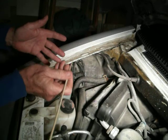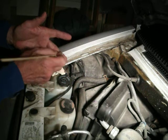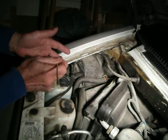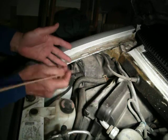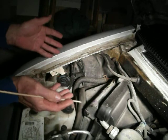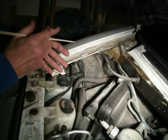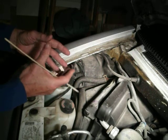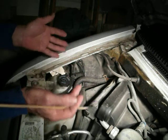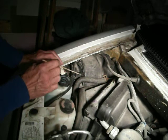So if you take a little piece of wood or something and just run the brushes backwards in their holders, blow them out with air, get some of the dust out. Mine seemed to be free. I also cleaned out the commutator grooves with the same little chunk of wood. I don't know what stopped it from running. When I got it out of the car, there didn't seem to be extra friction there, but once I put it back together all lubed up and cleaned out, it worked. So whether a brush hung up, I don't know. But this turned out to be a free fix.